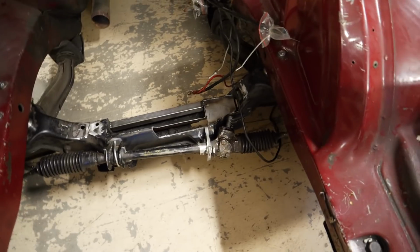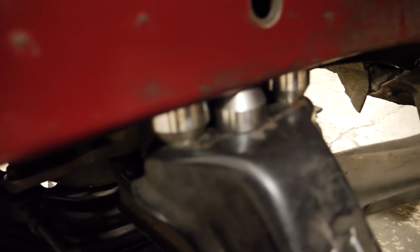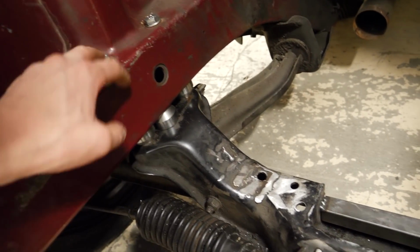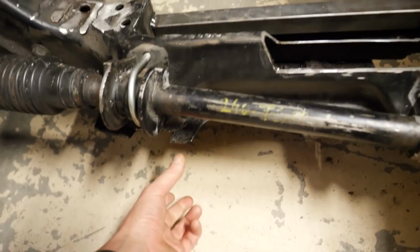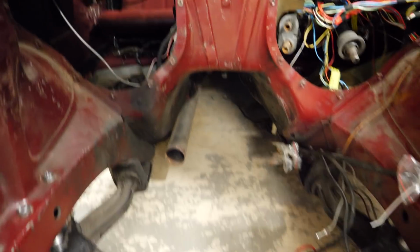The steering rack, it's just a temporary one there now. One thing I have made here to see if the engine will fit is some spacers. I moved the front beam down a little bit, with some longer bolts and the spacers, so it will have a little bit worse ground clearance, but it's still good ground clearance in this car. So I will test with this one and see how it will fit, and maybe I need to move these down as well and do some modifications here, but we'll see how it fits.